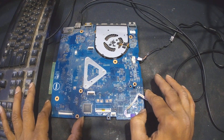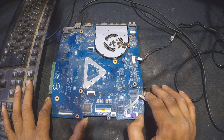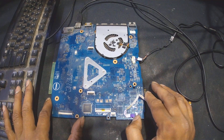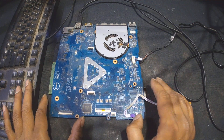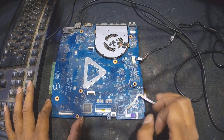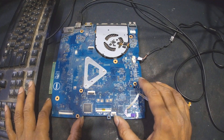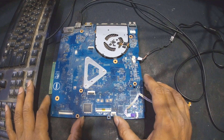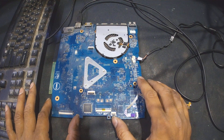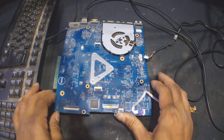What I will do is a little cleaning of this motherboard: use the heat gun for slight reheating, clean the RAM and processor, change the thermal paste, and then repack everything. Right now it is working fine, but if there is corrosion or any part creating a short, the motherboard will stop again. I will check one by one — keyboard, trackpad, and all ribbon cables — after replugging to see if any of them cause the issue.